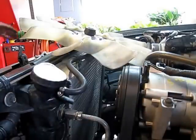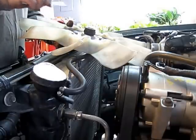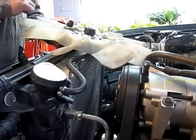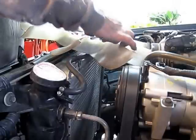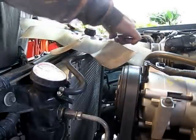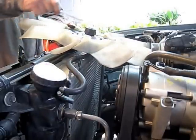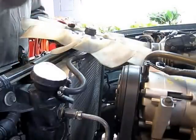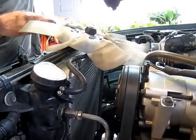I'm putting the fan back on the clutch now. I want to point this out because if you're new to this — these screws are going into aluminum. How tight should they be? Everything has a torque spec; look it up. It's probably in Newton meters, but once you've got it to a certain point, just give it a good snug and don't pull too hard. I'm just using two fingers and my thumb against the blade and giving it a good pull. You'll hear maybe a little creak — don't go much further because you'll strip it out and then you'd have to learn how to use a threader. So let me get the fan shroud and slip this back down in there just the way we took it out.